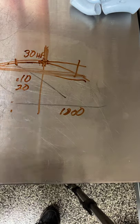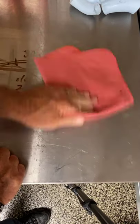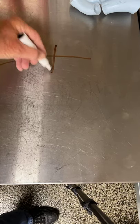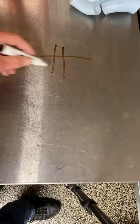But if you dyno this guy's motorcycle and it makes peak power at 6,000 RPM and you set his rev limiter at 6,200 RPM, I'm going to outrun him because his dyno curve will look like this. And this is where peak is, and you set his rev limiter here. And when I race him with the same motorcycle, or he lets me ride it, first thing I'm going to do is move the rev limiter out of the way.